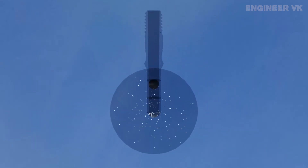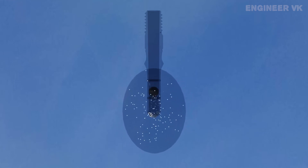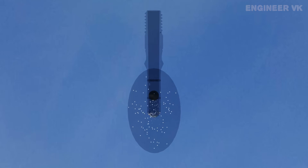When air inside the bicycle tire is reduced due to various factors, you can clearly see the ball inside the plug comes down due to air loss. You may ask that if the ball comes down, why doesn't air present inside the tire immediately escape outside through the hole. It doesn't happen because there will be a tube covering the plug — the tube is actually the main barrier. In some designs of the plug, only the tube will be present and no ball will be present inside. Even if a small damage occurs in the rubber tube, the entire valve will fail.